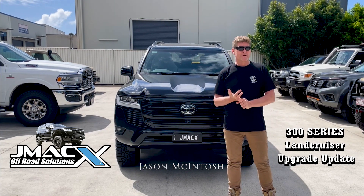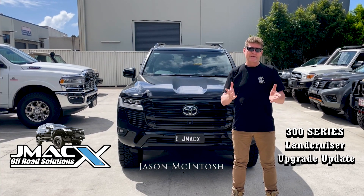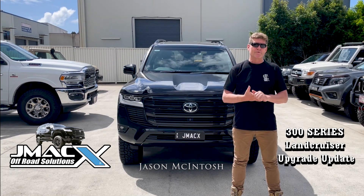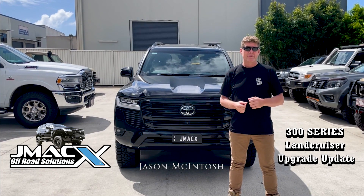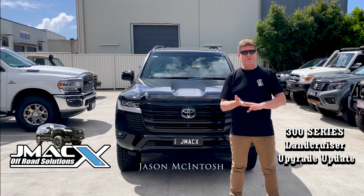...the GR Sport — because it has a low axle load in the front of the vehicle — bull bars and winches and that sort of stuff. The GVM that we do replaces a lot of the components that are needed to rate that vehicle back up to where it needs to be to support all that equipment. So yes, for the GR Sport, we can do all of that.